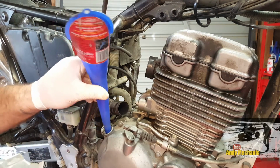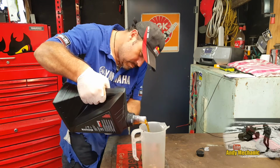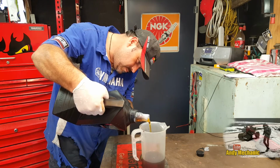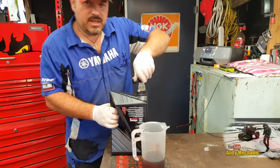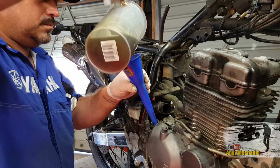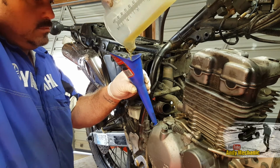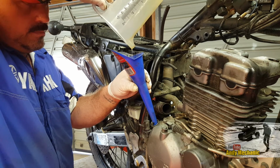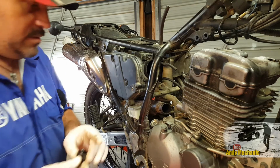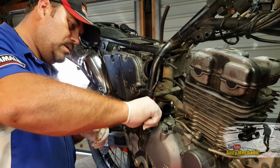Right, so what do we need now? Another 400 ml coming up. Right, 400 millilitres. Perfect, that'll do for now. Once we get the engine fired up, another day, I'll do a top up. Super job. Excellent. Now just make sure that the O-ring's all the way down on the cap before you put it back in again. There we go. And don't over tighten them.